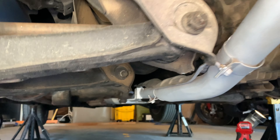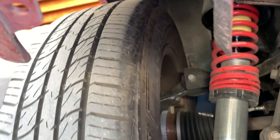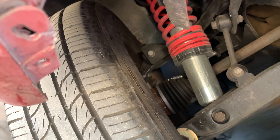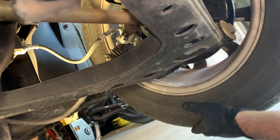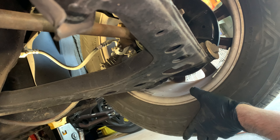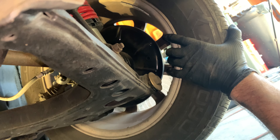We're under the car. The handbrake is on, the car is not in gear. We're going to push on this wheel here — I'm trying to move it and it doesn't move. So this is at least holding the force of my hand, which is not very much but it's something. Over here on the passenger side rear wheel however, it's spinning freely. So it's logical to deduce that the reason the car may be rolling back on a hill is because there's only one wheel holding it in place.